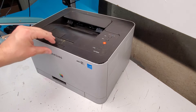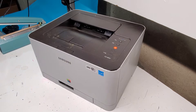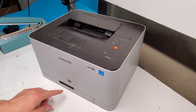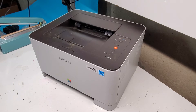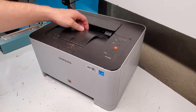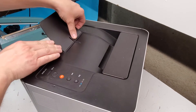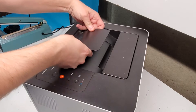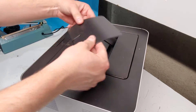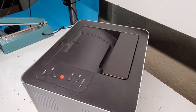There are similar models to it that have similar build. So we're going to start — we're going to need a Phillips head screwdriver — and we're just going to start by removing parts that are easy to remove, such as trays. We're going to pull this one out. This is the output tray. To remove it, we just press in the middle, push it to one side, press in the middle, and pull it out. Make sure these tabs don't break, and then reverse to put it back in.